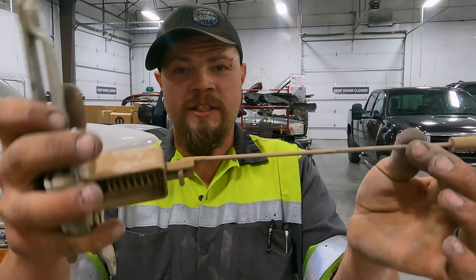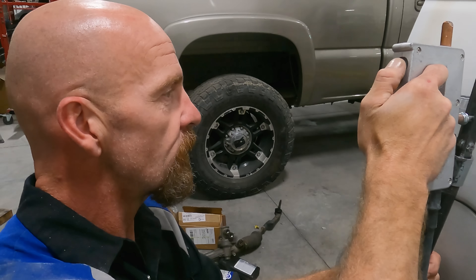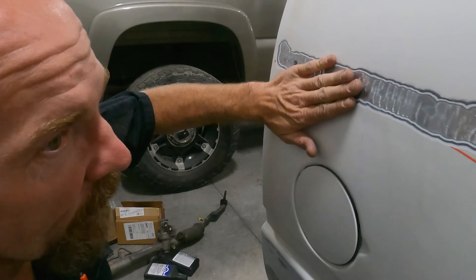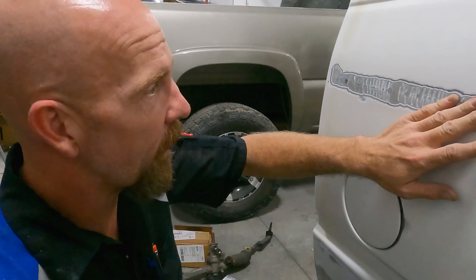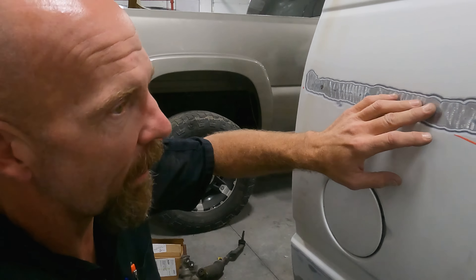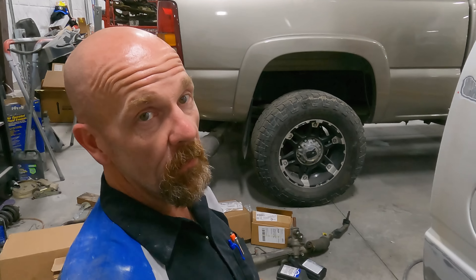Second latch expertly removed, just like the other side. There's a light crease — like a branch or something went down it, or someone's mirror. Just going through and pulling it out. I've just ground off the paint where the dent was, where the actual crease is. There are a couple layers of paint on here we've got to feather out, but we'll just go through and pull this out, feather everything in, do a coat of filler, sand the filler.